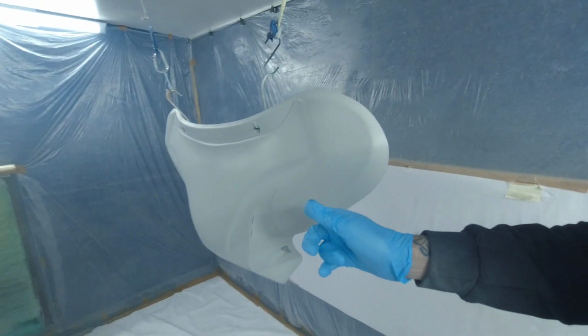So the next thing to do is mix your base coat. Now, we don't need a lot of base coat for this, just a good coverage. We're going to go in light, do a nice sort of, not full wet coat, just a closed coat but not too heavy. Just so you see it darken the panel off. You'll see it more so on this because it's grey primer underneath. These are just going to go black, so you'll just be staring at black.